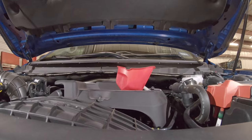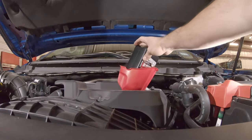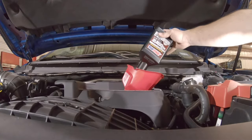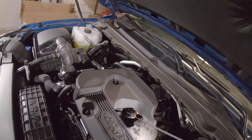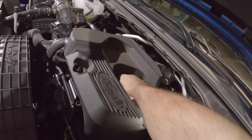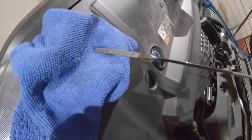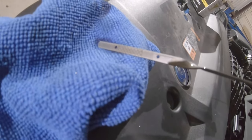Now that our oil filter is in, double-check that the drain plug is in and we're ready to pour the oil in. I like to let the bottles sit for a second to let it all drain out. I've got my cap back on there and my dipstick out — I just wiped it off. Checking the oil level: it's right there in between that little hash mark area and below that second dot. Perfect.